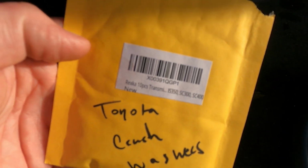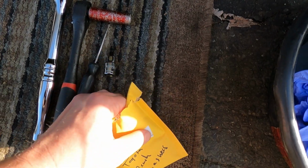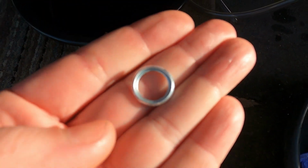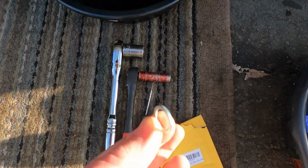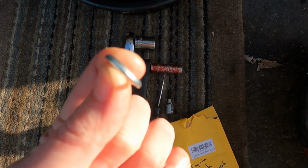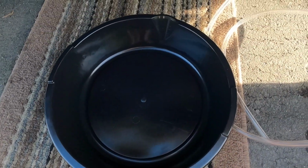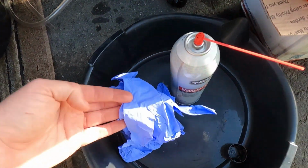So also pick these up on Amazon. I'll put this in the description, but these are basically just little crush washers, one-time use. When you do this, you want to drain and fill this a few times because you only get about 2 to 3 quarts and the system holds about 10. So I just reuse these on all the different flushes, and on the last flush I'm going to put the new one in.